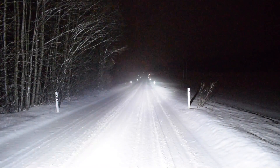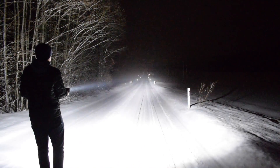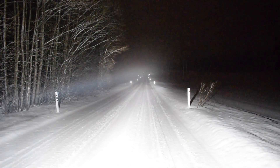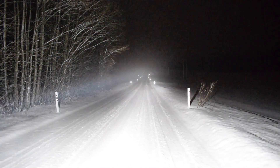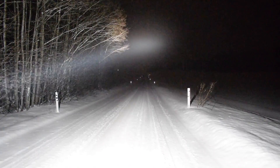Here is the same light with the 75 watt xenon. As you can see, I'm now able to see further down the road — as measured, it gives 100 meters more at one lux. The main hot spot is also bigger. It's shining up a larger area and the hot spot isn't as tight; it's more of a gradual transition from bright to dark.